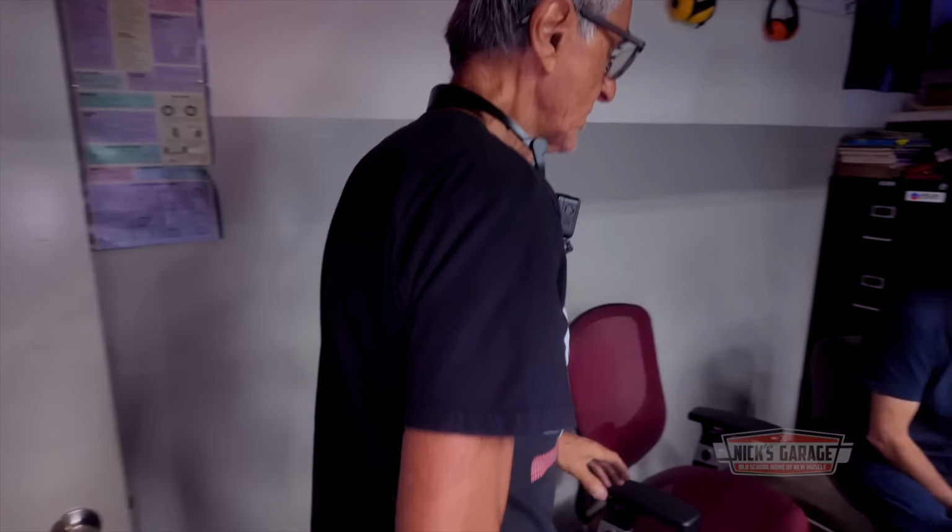All right, I have an opinion to input here. I see the camshaft here. It's made to pick out around 56, 57. This cam is made to make more torque. It's more like a street cam. That's why you have a lot of torque compared to horsepower, the cam. I see the timing events on this thing. Yep. That's why you want 28 degrees.